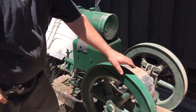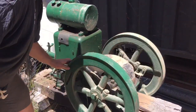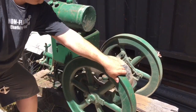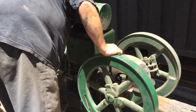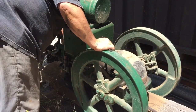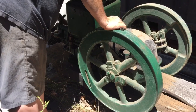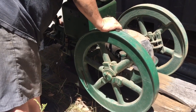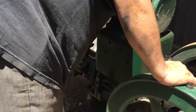Secondarily, we didn't have compression. The motor had sat for a while. But we've got compression there now. The issue I found was up the front — there's a valve. Because it had been sitting for a while, it had a bit of corrosion or crack or some sort of congealed muck on it. So I just ran the valve circular on its seat to basically give it a chance to scrape off whatever was on there.